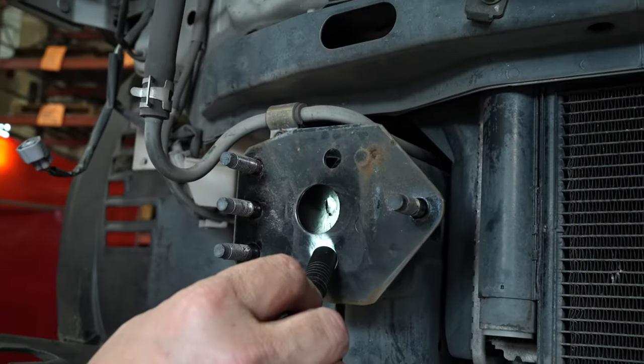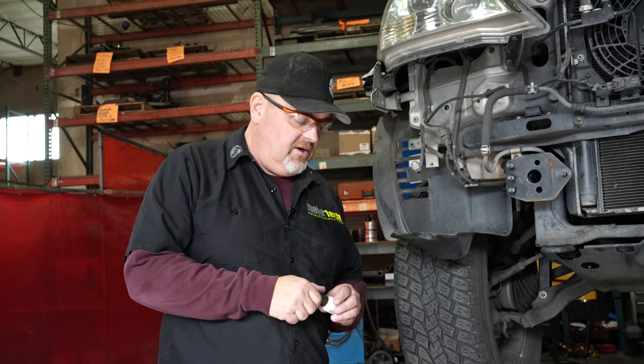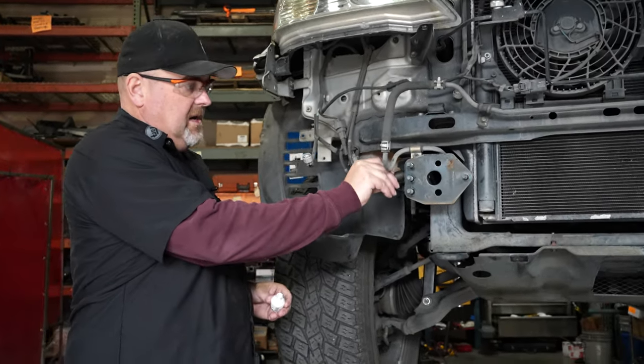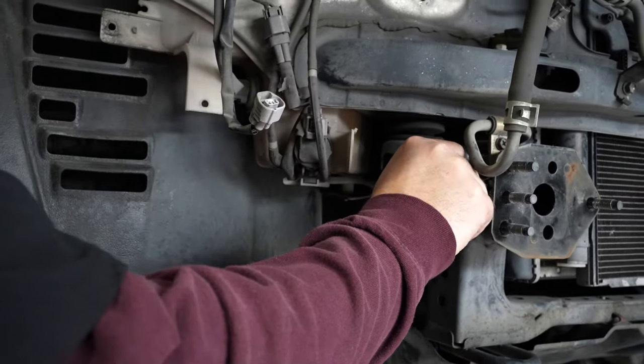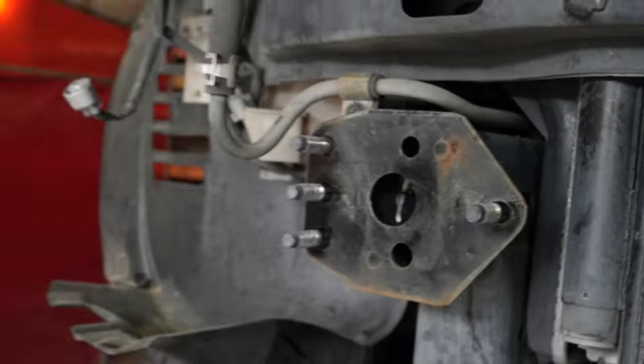As a good installer, I drilled a hole through the frame — it was an existing hole, I just enlarged it. Of course we now have raw steel there, and anytime we have raw steel you want to seal it up. So we're going to use our installer trick of fingernail polish and put paint on all of the exposed raw steel. If you want to see more about the fingernail polish trick, we have a separate video talking about it and showing other areas we've used it.